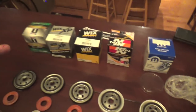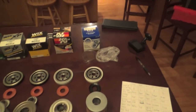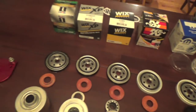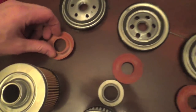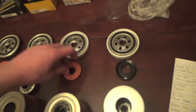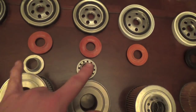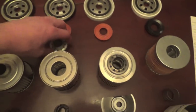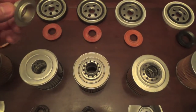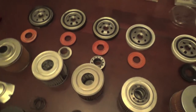They all come in cardboard box packaging — the only difference is the Mopar Viper filter comes with a lid and a plastic bag to keep debris out. On the lids they all have six feed holes, not much difference there. Going to the drain back valves, the only difference is the Viper filter has black rubber compared to the red rubber on the others, and the red ones have a powdery dust on them, likely because they sit in a cardboard box. On the Wix filters we've got some weird little adapters — one is a bypass valve and one is just an adapter, and there's no rubber sealant, just sheet metal to sheet metal, which is kind of sloppy.